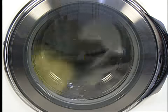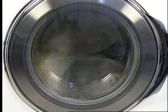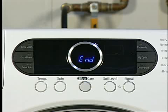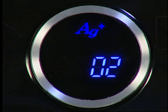To terminate this quick cycle, continue pressing the Temp key. 'End' will display once the cycle is complete. Selecting the Power button will end the quick cycle. Check for any fault codes after completing this test by pressing the Silver Care button in the service test mode.